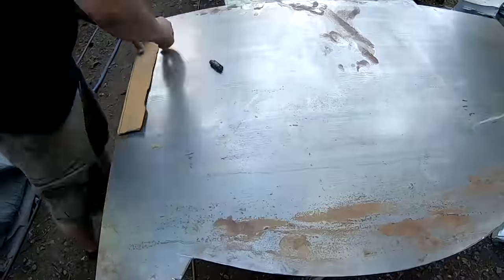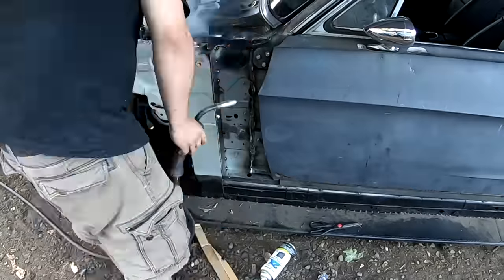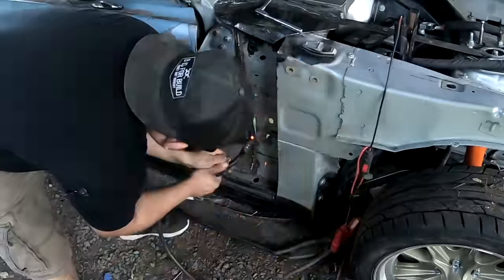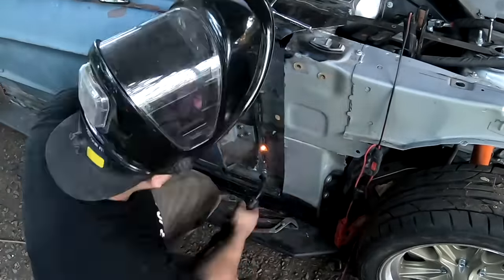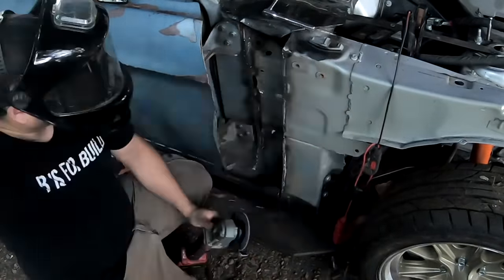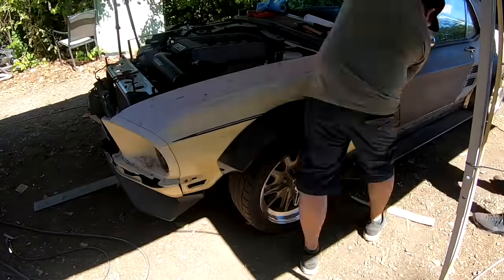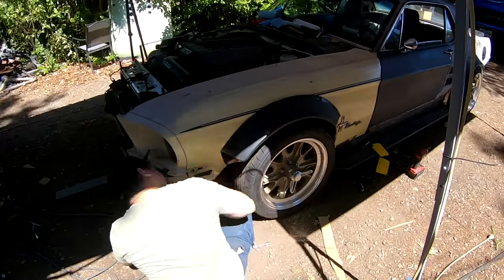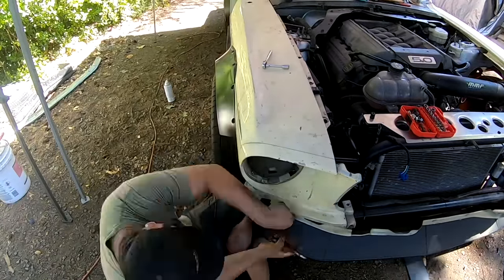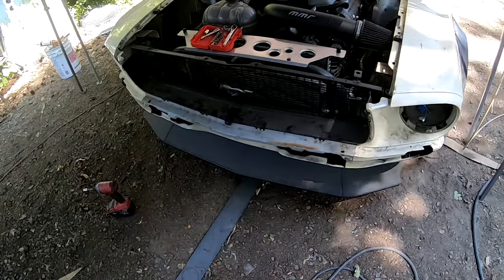In the sides here it's all about reinforcing the steel where the door and frame line up — you really have to bolster that steel in. We'll see how well it holds together if the car flexes too much on the track, since this is probably the weakest point of the car. We tried our best to box everything in, and you can see Oscar went real hard with the seam sealer, which is a great idea to keep that area weatherproof. Just cover every seam with seam sealer — it's a really nice way to finish it off.